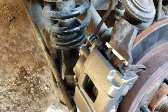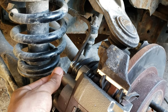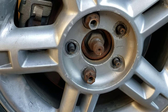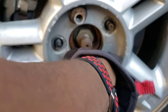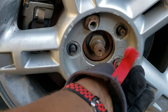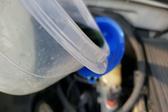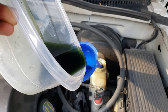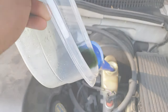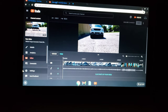This is the finished product. We already bled the brakes — we added more brake fluid and we're gonna go from there. We want to tighten the wheel bolts in a star pattern so that the wheel won't fall off. We got the wheel on there and we're gonna go ahead and recycle the fluid that we drained. And that will end the video of the rear brake caliper replacement on the 2002 Ford Explorer.